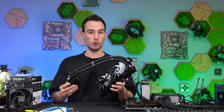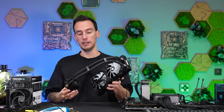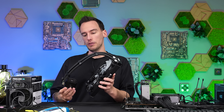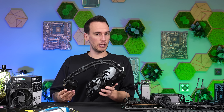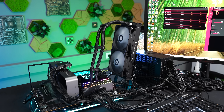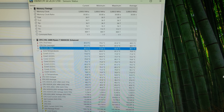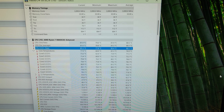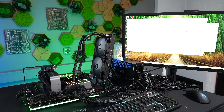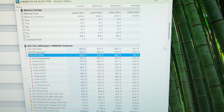The last thing I want to test is the same AIO in the 240mm version — just double the surface area of the radiator — to see how much that helps and if it can bring the AIO ahead of the Freezer 36. However, this is a different price category at about 44 euros, still super cheap but not quite comparable. Also, two fans are louder than a single fan, so I had to go down from 80% to 73% fan speed to maintain 40 decibels. The result looks a lot better: 80.1 degrees Celsius. At 100% fan speed, it barely helps: 79.4 degrees Celsius.